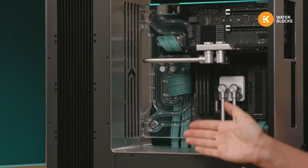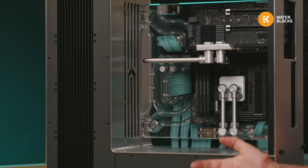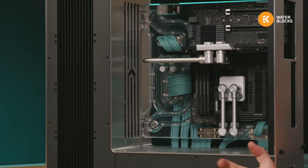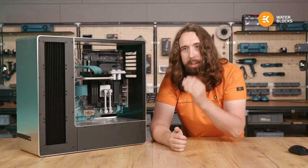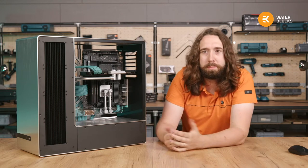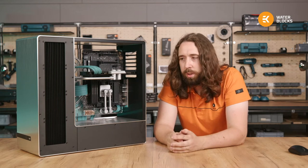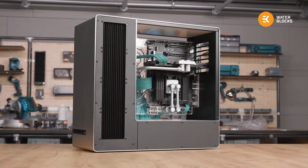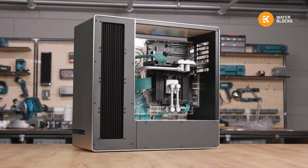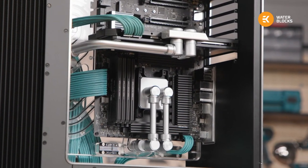The radiator is engineered such that it has the biggest surface area possible, whereas a tube, being a perfect cylinder, has the minimum surface area for its volume. That's why tubes are so good in loops, and why round tubes are better than square tubes or hexagonal tubes, not because of the forming of them or the making of fittings, which is obviously easier, but also they have the smallest perimeter versus cross section, so the least restriction.